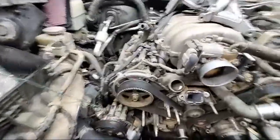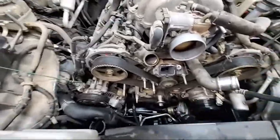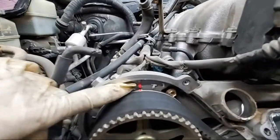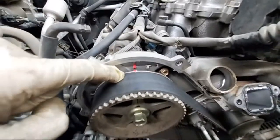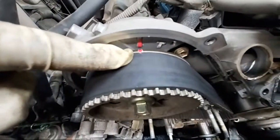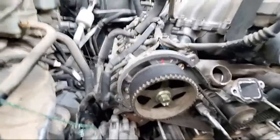The main purpose of this video is gonna be the timing marks. Before you remove the timing belt, you're gonna spin the engine around. These are the timing marks right here on the timing cover — there's a 'T' for timing and there's a line there. On your camshaft sprocket it's gonna have a notch in there, so that notch is your marking right here so you can have an idea where the position is.